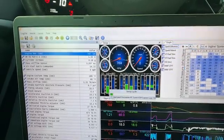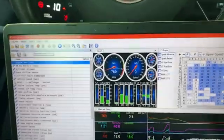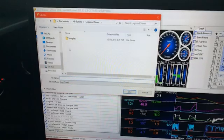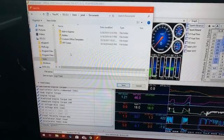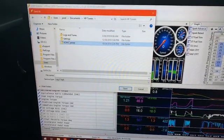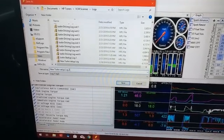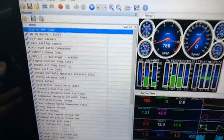We're going to finish it off — we basically go over here and click 'Stop.' It's going to stop recording right here. Disconnect from vehicle — we're done. It automatically saves it and gives it its own name, but I always go over here to 'Save Log File As.' I'm going to pick my location. I saved mine in 'Logs' — 'New Turbo Setup Log' is what we're going to do, because this is the first or second time we've logged on the new turbo. Boom, saved — so now I'm good to go. Disconnect from down here. We're disconnected, we're good to go.